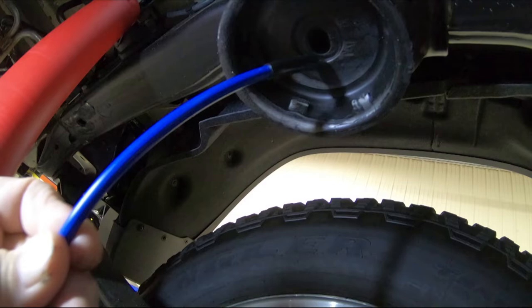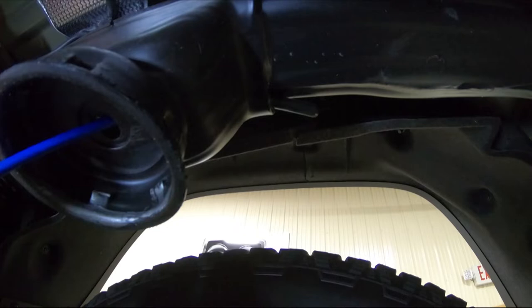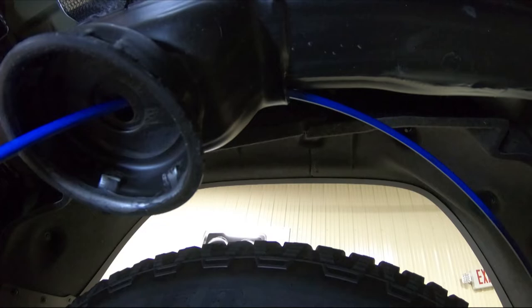Pre-route air line up through the frame weldment and out the back side. Place assembly on axle and completely insert air line into the push-to-connect fitting. Air lines are pre-cut straight and have a black protective cap installed to aid routing and keep the line clean. Remove after installation.